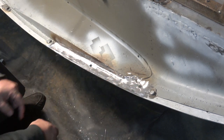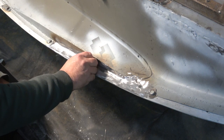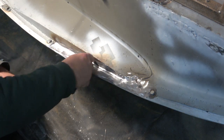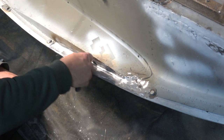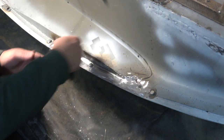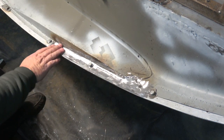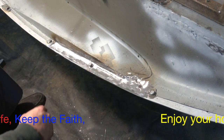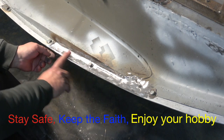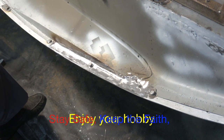As you can see I've got it all cleaned up there, it's nice and flat. It's not finished completely, but there's a nice round hole there which is completely leaded in and I can put the bolt back in by hand, and then I can put a washer over that to hold in the outer wing. And that's basically how it's done. I've got to clean all this up a little bit — it might need a very slight bit of filler over it, just a skim basically. That bit there I've got to clean up a bit more but it's pretty flat now. It should accept the outer wing really well, and I'll go on and do the rest, but that's the basics of it.